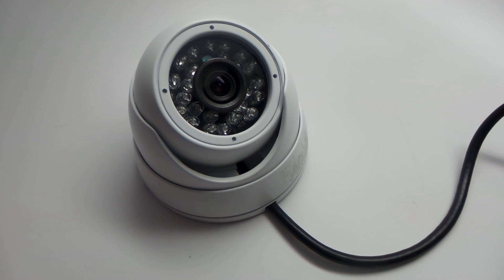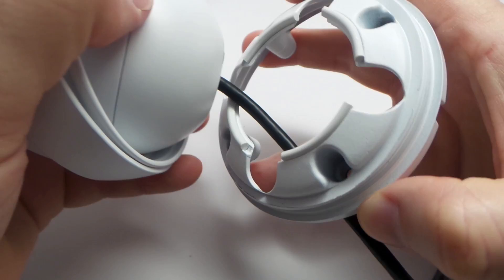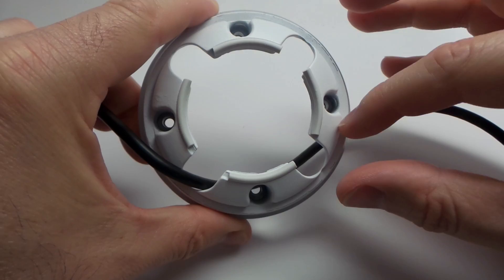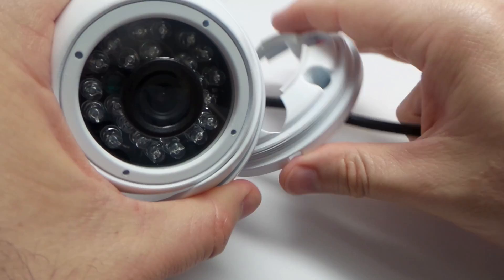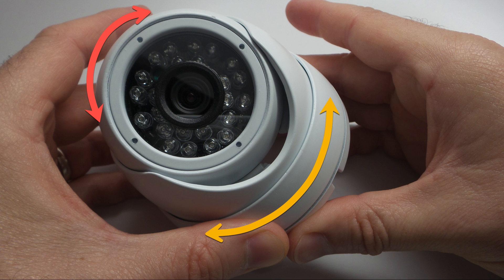The HD Q3 is simple to install. The mounting plate is removed by unscrewing the base plate. Then the installer can mount the camera base to a ceiling or wall using these four screws. The base plate is then reattached. The eyeball camera piece can be swiveled in any direction before fully tightening the base again. This eyeball design allows the camera view to be adjusted very precisely.